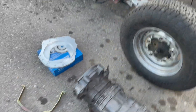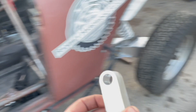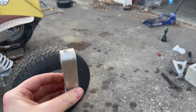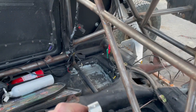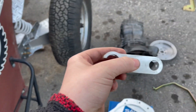I'm going to slide the transmission in and bolt it up, and then we'll deal with the shift coupler, which I also bought — this piece here. I'm not entirely sure if this is going to work yet, but it's worth a try. This piece supposedly will adapt from the shift linkage inside the bug tunnel and jog it up to the nose cone of the bus transmission. I've heard mixed reviews, but it was seven dollars so I figured it's worth a try.